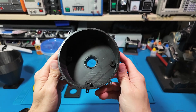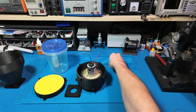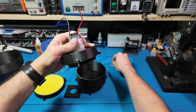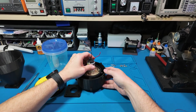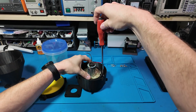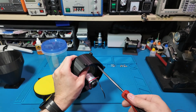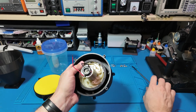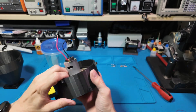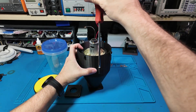The cyclone body prints whole, but the motor and filter are stacked on top. I did try it with a brushless motor but struggled to get enough suction. This handheld was $8 at my local Goodwill, so I thought why not try it? I used self-tapping screws for most of the assembly. The lid adapter screws onto the food container and holds tight. The motor mounts directly to the top using a ring and the rubber that was on the motor, which aids in vibration dampening and sealing.